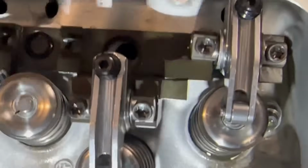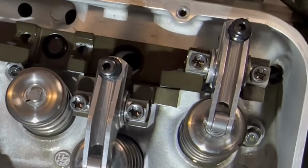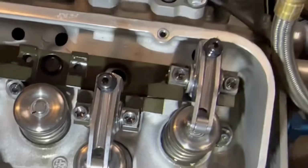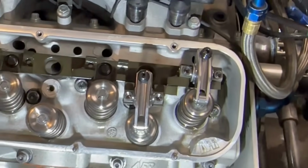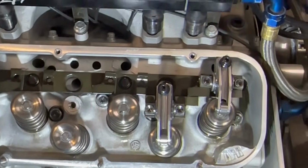So now we got to get push rod length, and maybe we'll get lucky and the ones we got will work, or maybe at least half of them will work, because remember, one of them is a lot longer than the other. So we use 3/8, 135 wall.